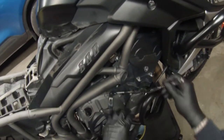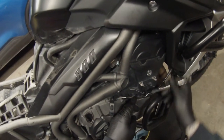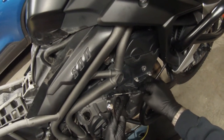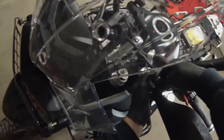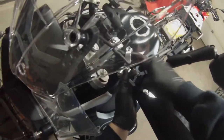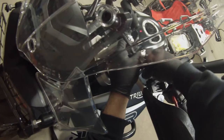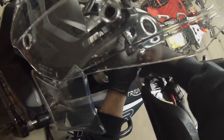It doesn't really matter which end you start at, but you're going to have to loosen your cable right off. All that is is a 12mm and you're just going to wind that out. Basically you want this one all the way in so that you can go like that. Then we're going to go up to this one and wind it all the way in. You just want as much slack on the cable as possible.